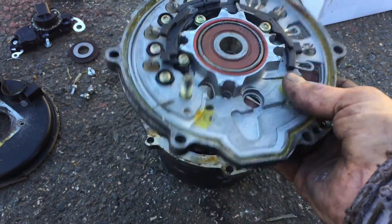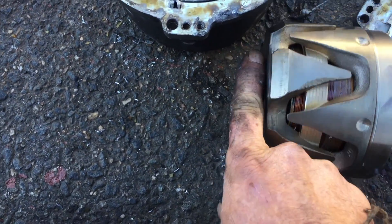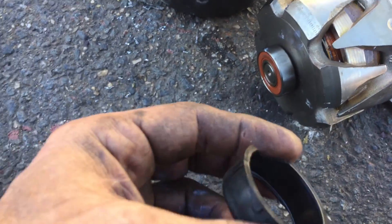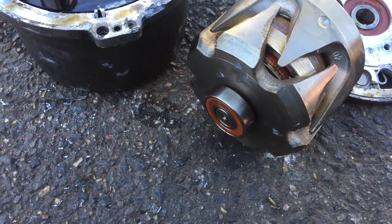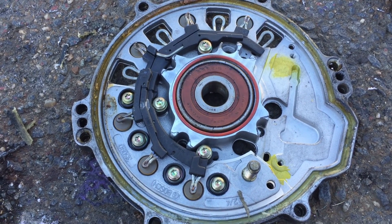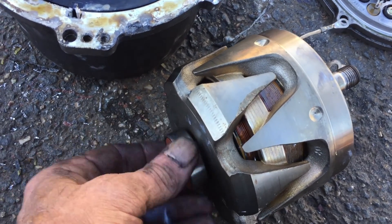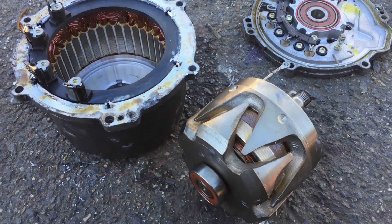With the plate removed, that's our alternator in a nutshell — there's the rear bearing, your windings inside, everything's there. The rear bearing has to be pressed on; there's a piece of plastic that goes over it. Mine — the bearings are fine, they don't move at all, so I'm not going to mess with pressing the back one. I'm going to go ahead and replace the front one because it's in the diode housing itself. If your bearings are bad and it's squealing and making noise, you've obviously got to do that, but that has to be pressed on so you need a press or take it somewhere. Mine's just not charging, so we're going to move on from there.